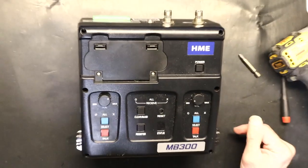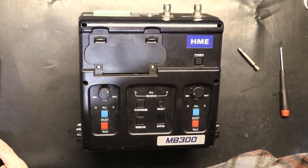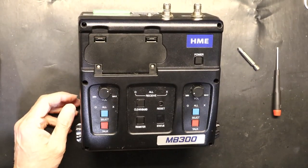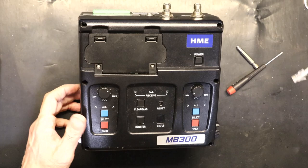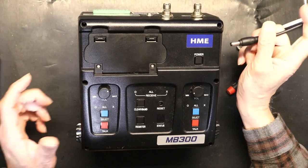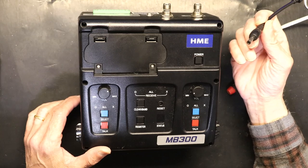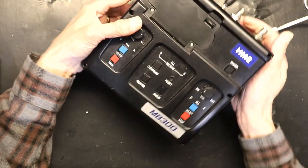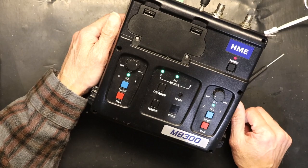Now let's plug it in. Make sure the surgery was successful. So I'm plugging it in. The power supply for this is 12 volts DC, center positive, 5 amperes. And the tip size is 5.5 millimeter by 2.5 millimeter. Okay, it's not 2.2, it's 2.5. All right, so we plug it in and we turn it on and voila, everything looks good.